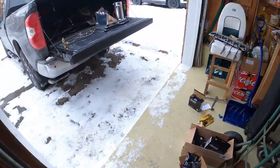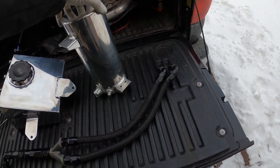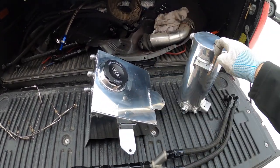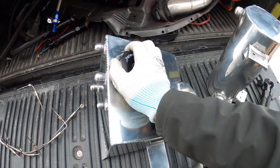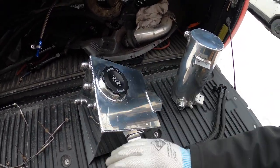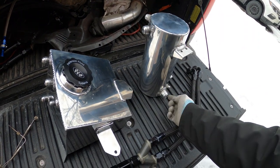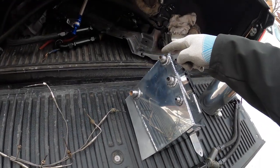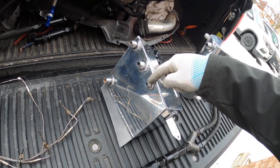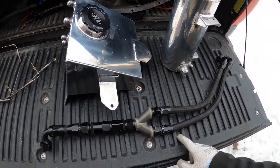We're planning to do probably 85 pounds of boost through that thing, so rubber couplers are not going to hold together. Also be doing the fuel system today, thanks to Fab Lab Performance — follow them on Instagram. He did some custom tanks for me. These are both fuel tanks: this one sits in the engine bay where you fill the fuel, and this will be a secondary tank. Combined, there's over two gallons of fuel, so this should be plenty.